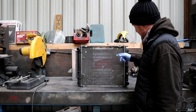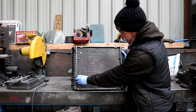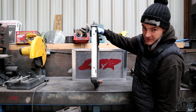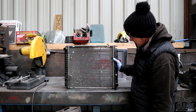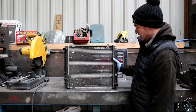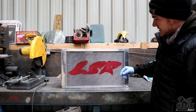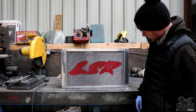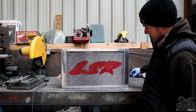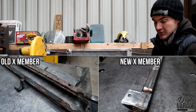One of the problems with Matthew's Volvo is the radiator. This is the radiator that was in the car — as you can see, it's been poorly repaired in the past, with leaking coolant in both bottom corners. It's also not particularly large in terms of core, and for a drift car cooling is obviously quite important. Aftermarket parts are pretty scarce because it's a Volvo, so Lee has made this ally radiator up pretty much exactly as I asked. It fits just inside the chassis rails with mounting tabs. I've also got to make a cross-member for the intercooler and oil cooler, which will mount just behind these.